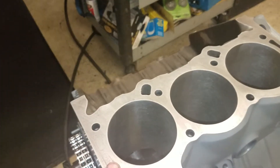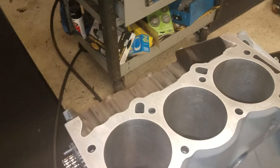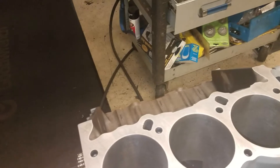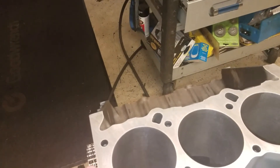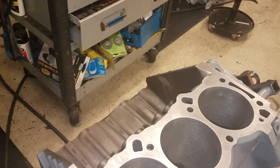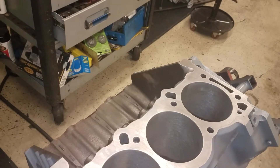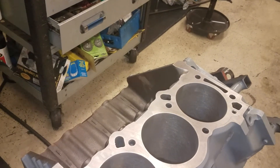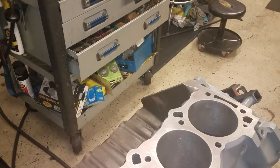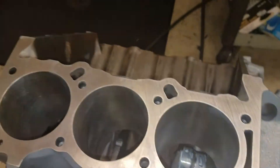Blueprinting it, just checking everything — so far everything has checked out really good. We got really lucky with the way they turned the crank, the bearing clearances came in pretty good with 10-under, because the selection of bearings at 10-under is not the same as standard. There are no 11s, there are no 9s — with standards you have plus-ones, standards, and then HX's which are extra clearances. I use those all the time.